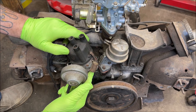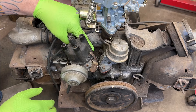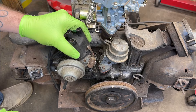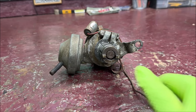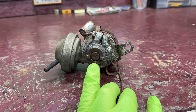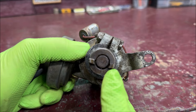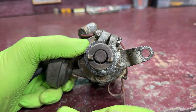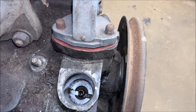So, about not loosening that nut: you want to be able to just pull the distributor without moving the timing. You'd go down and hit the 13mm nut and pull the distributor out. Now, this is what goes down inside the distributor drive gear, right down inside your engine case. See how one side is shorter than the other? There's a larger side and a shorter side. When you're putting it into the engine, it will only go in one way — shorter side and longer side have to line up. That's very important.